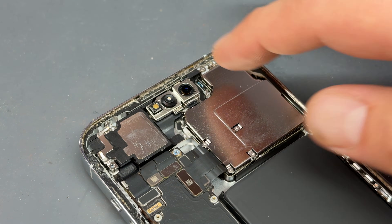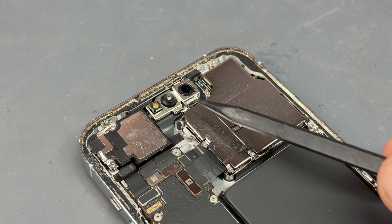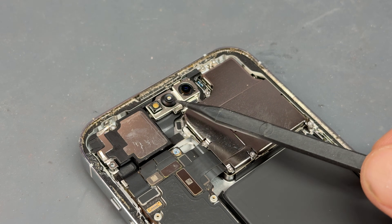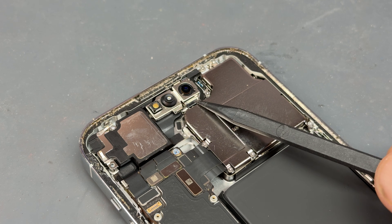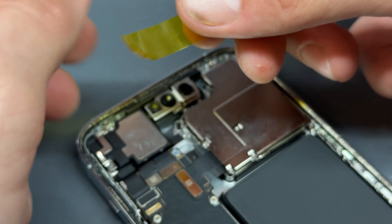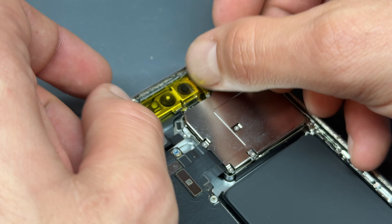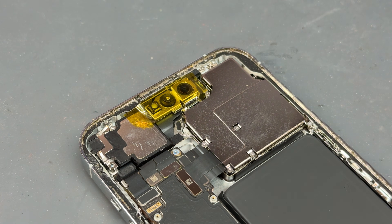Because we're going to be removing the camera lens, there are going to be a few shards of glass kicking around. These little cameras are very sensitive — that's the dot projector, infrared camera, and the front-facing camera. It's always best to protect these with a little bit of Kapton tape or any kind of low-tack tape. You don't want something that's going to leave a lot of residue behind. Just go ahead and put a strip over these cameras to protect them whilst we're working.